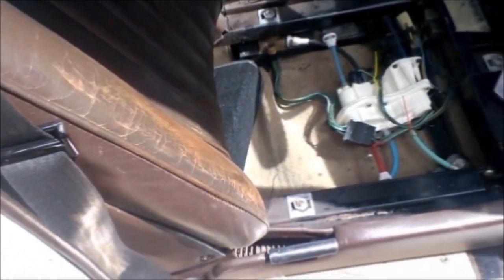If the car's not going to be used every day, then you've got plenty of time in which to do it. I'm now going to apply the second coat, and in this case you don't brush it on like I did before, you dab it on. Now I'm going to have to put the camera down while I put the paint onto the pad. This has now been moistened with water, so it helps thin it out a little bit. You don't want it to go on too thick.